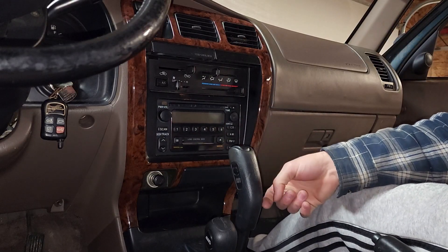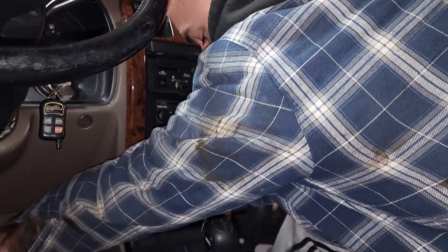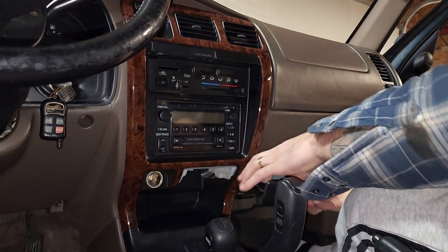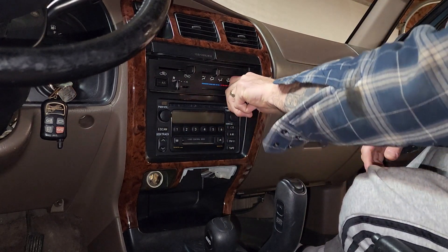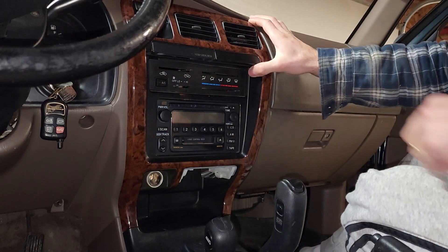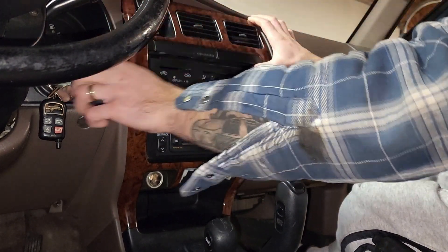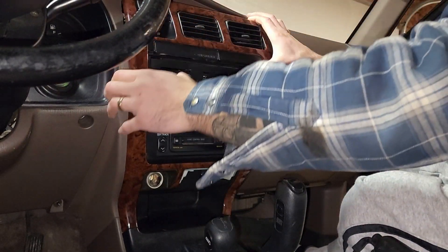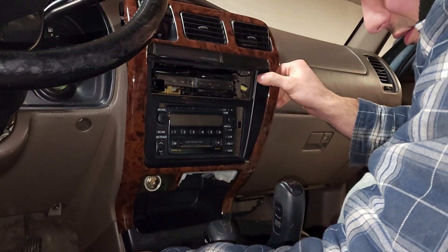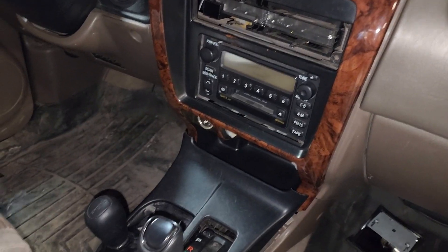To take this off I'm going to put my shifter all the way back just to give me some more space - just ignition on with the truck off, hit the brake pedal and push that back. The ashtray can come off as well as the cigarette lighter, and then these little knobs just pull off. This center part just has to pop off as well, just a little bit.